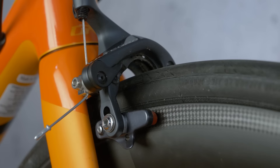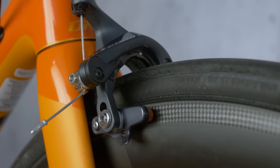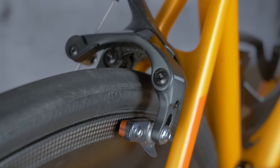So how can you tell if your rims are wearing out? Aluminium rims will begin to show some bowing or caving on the alloy brake tracks, but this isn't such a telltale sign on carbon braking surfaces. Carbon fibre rims usually have a layer of material laid over the brake track to give good braking performance, prevent heat build-up, and prolong the life of the rim. Underneath this top layer is the raw carbon weave. According to Hunt's Ollie Gray, carbon brake tracks are much more resilient than alloy braking surfaces — you should look for when the woven fibres of the carbon itself begin to become exposed or frayed.